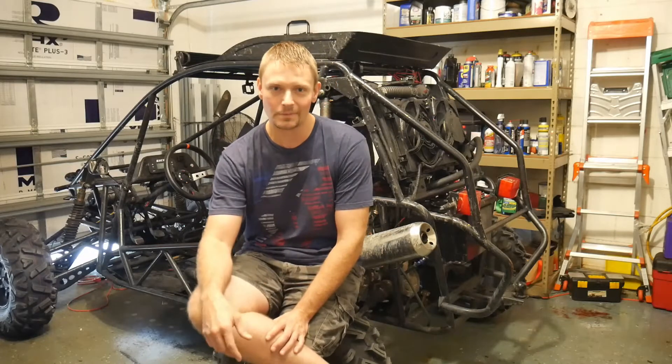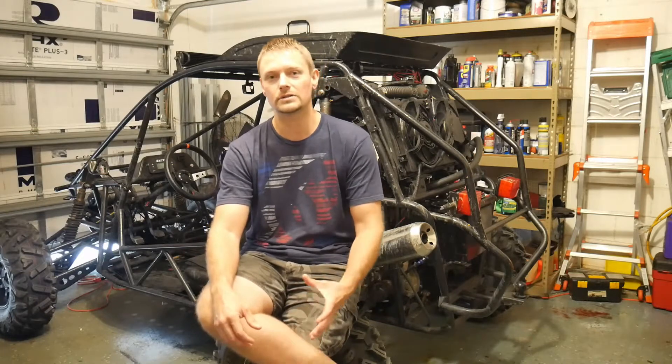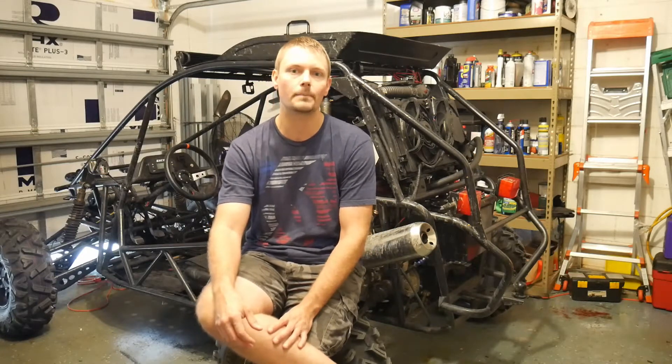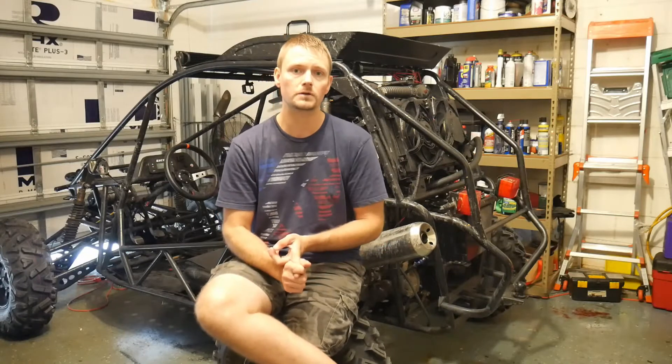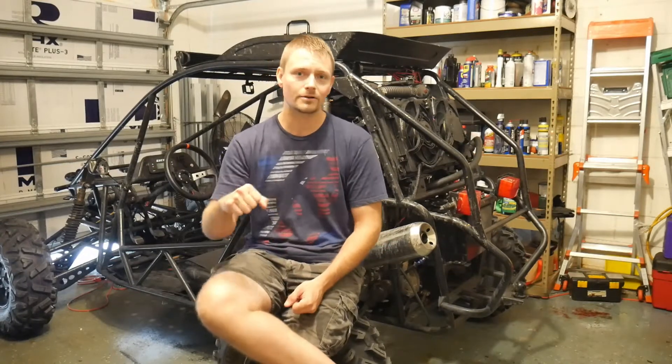So I'm super excited to let you guys know that we're going to actually be starting the engine swap series. This was a project I had planned for this buggy about a year ago. I looked into some of the options out there — I looked at doing a motorcycle engine swap, but if you put a motorcycle engine on a heavy vehicle like a dune buggy or small car, besides the clutch issues and strange gearing, you lose your ability to have reverse and that standard shift pattern from an auto transmission.